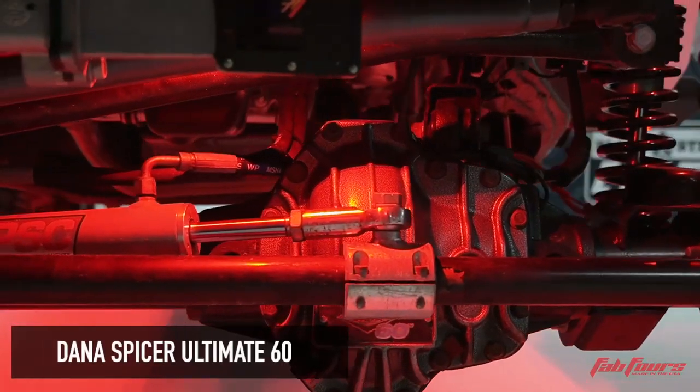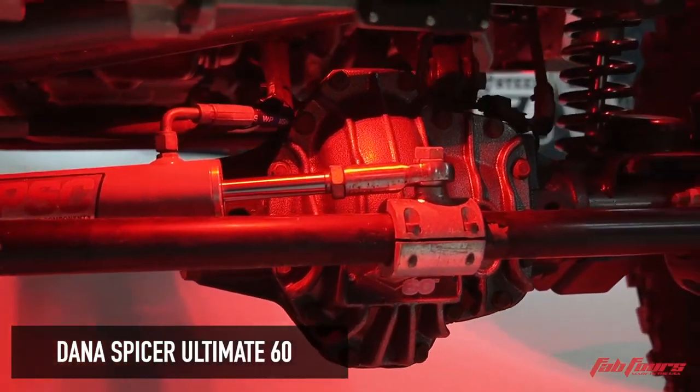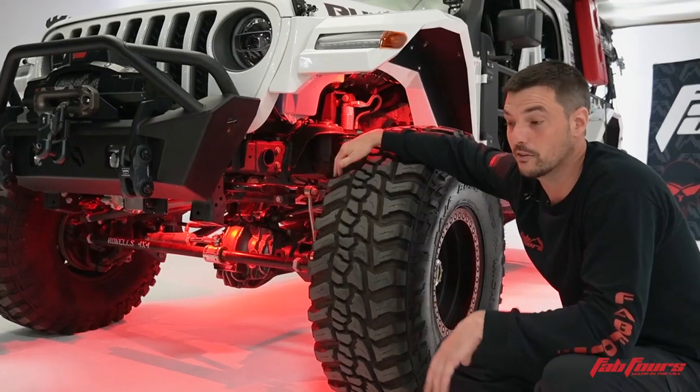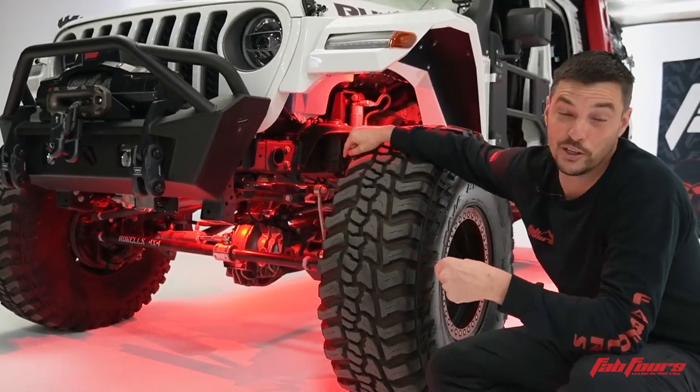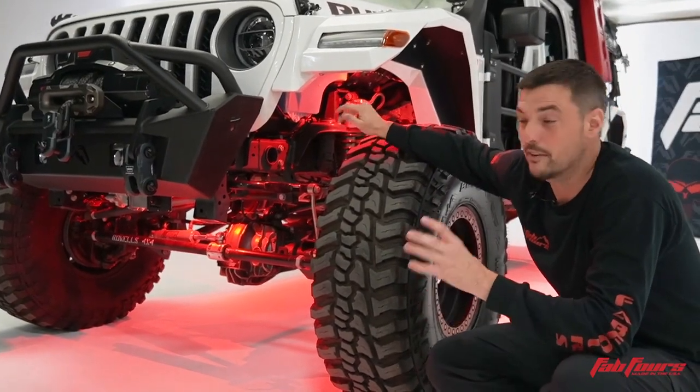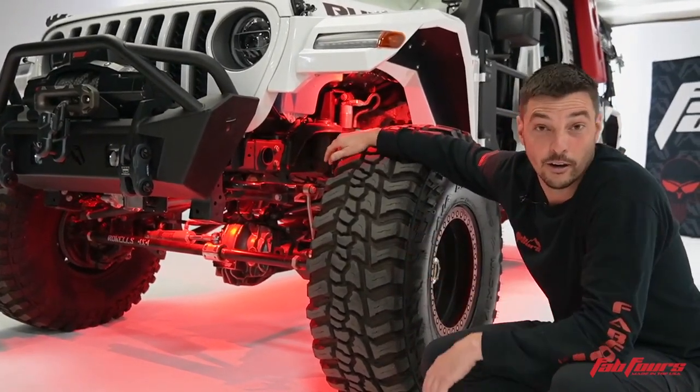That is the way to go. You know, one-ton axle swaps, you can get junkyard 60s from Super Duties, from old Chevys, run 14 bolts, whatever. But direct bolt-in sure makes life easy, the way they've done with all the bracketry already ready to go.